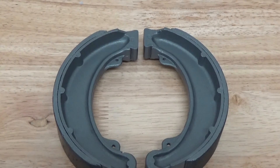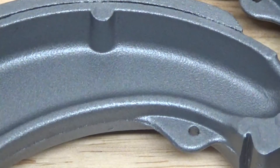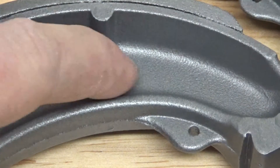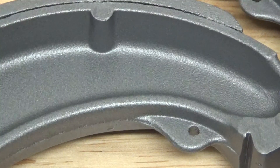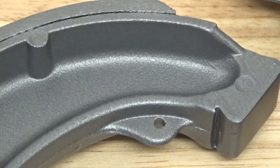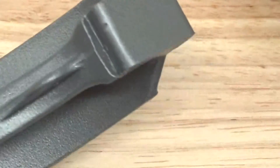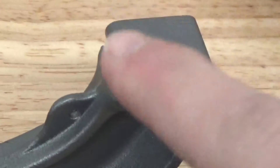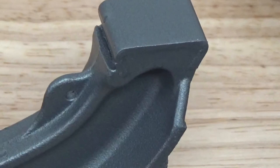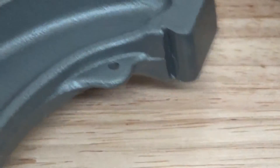The vapor blasting system gives you a really great result in much quicker time. I'm just going to zoom in so you can see the coating a little bit more in detail. Here's what the coating looks like — it's a very dark gray finish, very smooth, and it's a great coating for getting rid of heat if you need something like that for an application you have. Using a wet blaster vapor blasting machine to prep this part is very easy and very quick. This is a steel cap right here and it just coats and preps the piece very nicely.